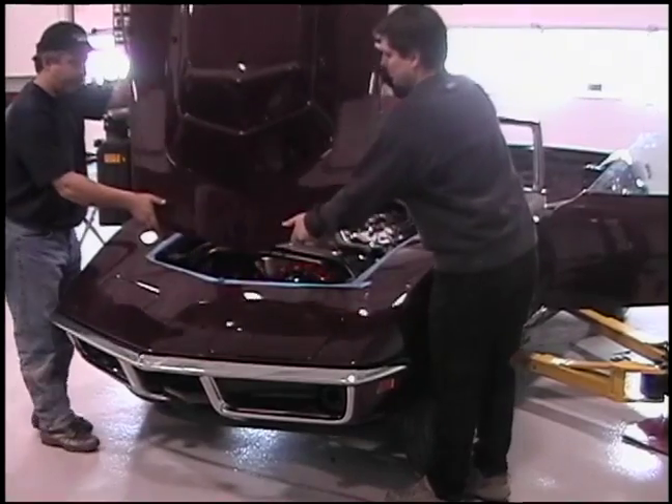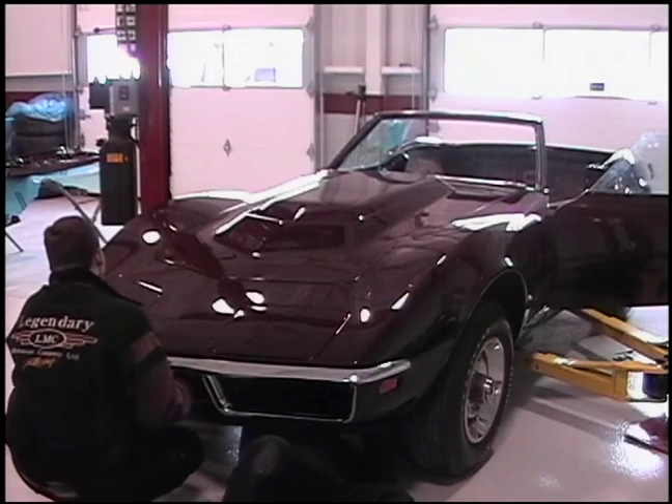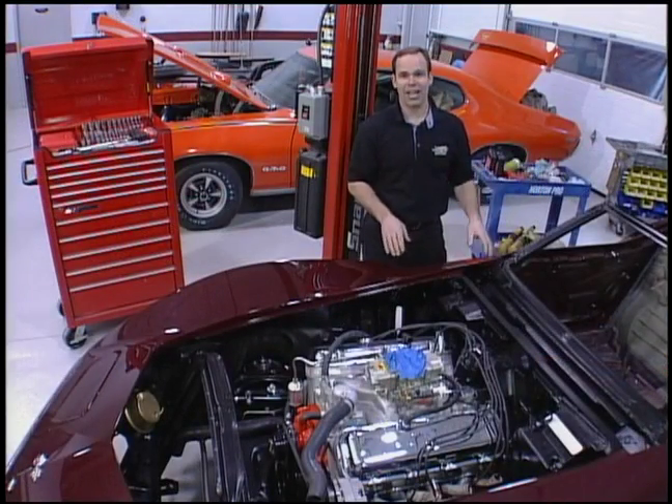Once that's done, we're going to put the hood on. In order to adjust the hood, we might have to move the body up or down. So the next step is to bolt down the hood, make sure that it fits the body, and then we can move it up and down. There's a fair bit of adjustment on a Corvette. If you go to the back of this car right now, I can lift up on the back and actually close up that gap a sixteenth to an eighth of an inch, just by hand. So you can see these shims are really important.